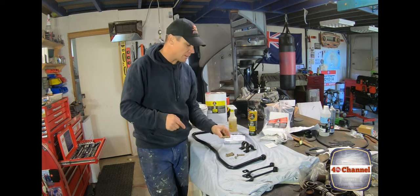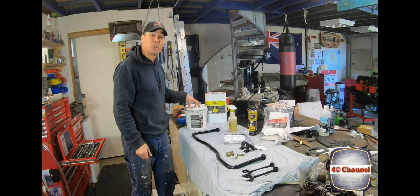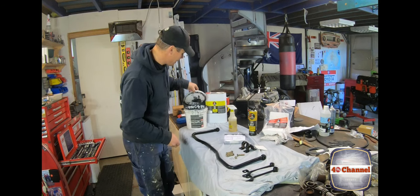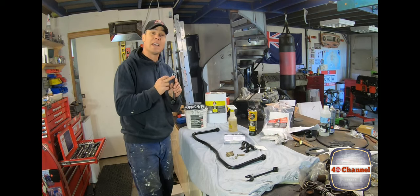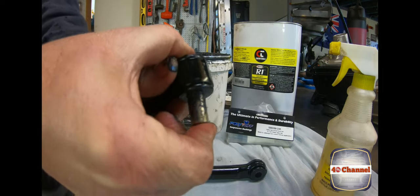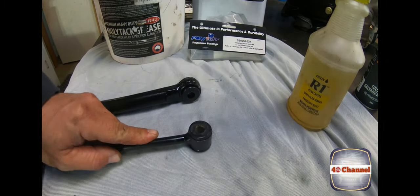From the bolt set we've got a little crush tube and a castle nut. I'm going to put a little bit of lithium grease — when you buy anything from Polytuff it all comes with some white lithium grease ready to go. I'm going to use the R42 from Chemtools, which is a lithium based grease as well, and I've just been using this over the entire 40 series cruiser. Just put a little bit of grease on the outside of the crush tube and slide it straight into our polyurethane bush. If you find it difficult to go in, just get a soft blow hammer or a copper hammer and tap it straight in.